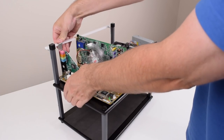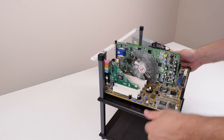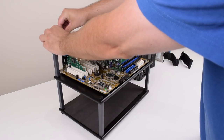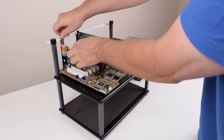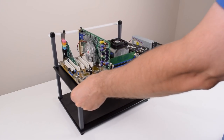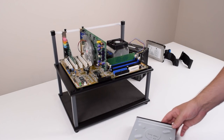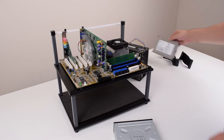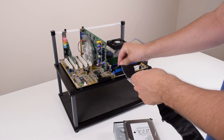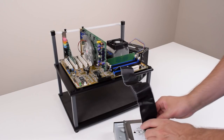Okay, I think it's time to start building this retro gaming PC, but we also have Windows 98 and DOS benchmarks. We will look at any CPU and GPU bottlenecks, enable anti-aliasing and anisotropic filtering to make those old games look even nicer. I'll show you how to more than double high resolution DOS performance. We have power draw measurements and we're using a PCI sound card that you can buy for around ten dollars that works great in Windows 98, but especially in DOS with a fantastic sounding FM chip.